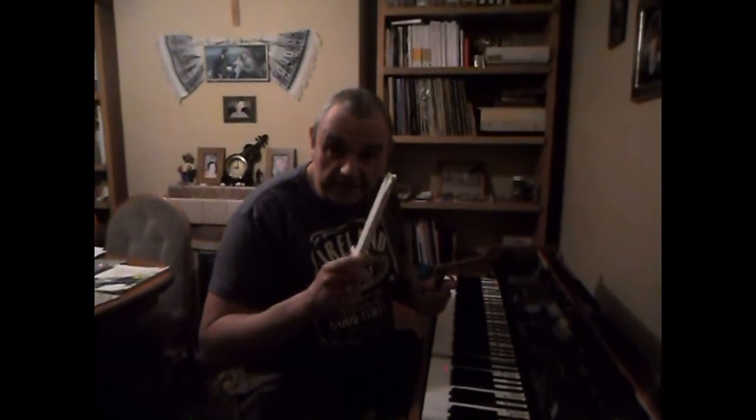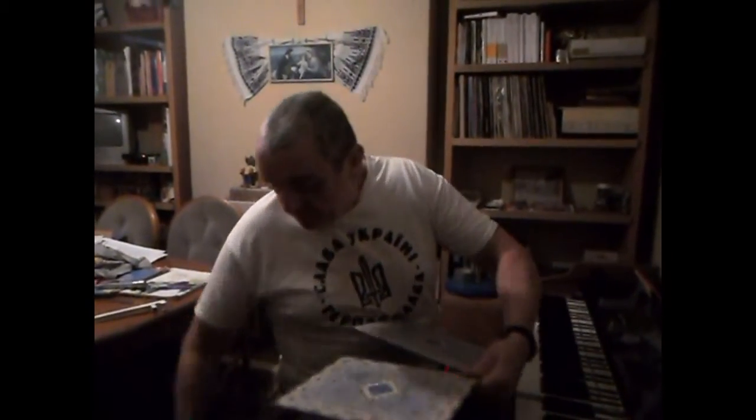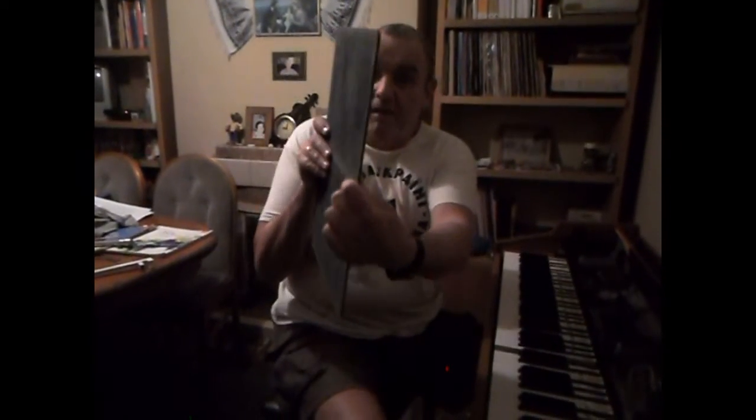I'm going to show you a little trick to fix that. Imagine this is the broken bit being stuck to the end of the key. That isn't sturdy. So, one solution to this is to get a standard business card that's shiny on one end. You'll want the shiny bit facing out so that it's smooth against the other keys. Imagine this is a bit of business card. So after gluing the broken bit to the key itself, you do that. Glue a cut-out bit of business card, and then that makes a sturdy repair.